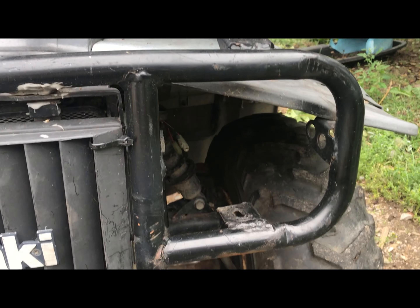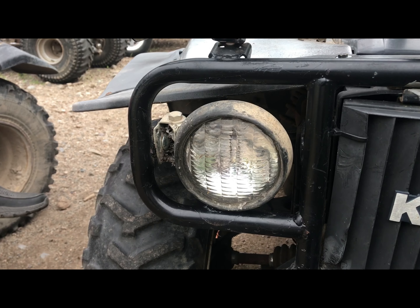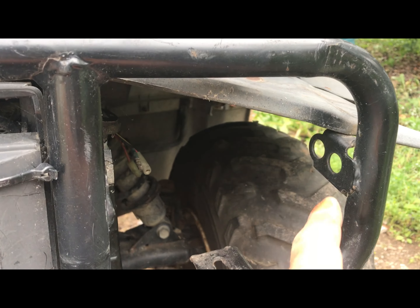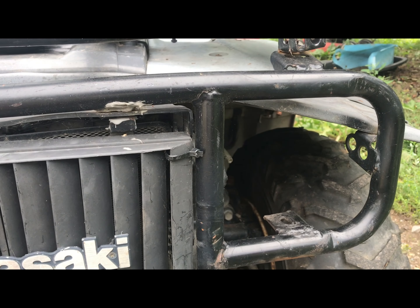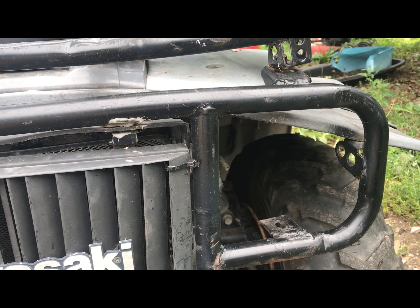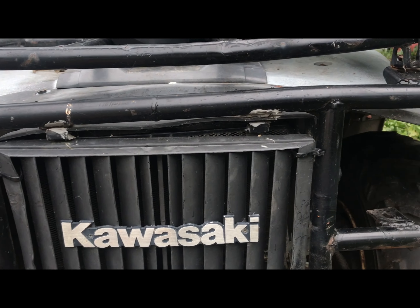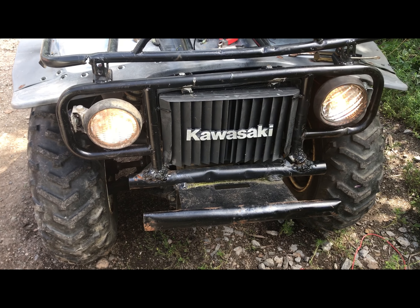This quad is missing its factory lights, so I'm just going to mount a bumper light. I'm going to use the side because on this side the bottom one is missing, and then I'll just wire it in. It'll only have low beams, which will actually be brighter than the high beams were because these lights put out 35 watts. And just like that, you have some hillbilly headlights.